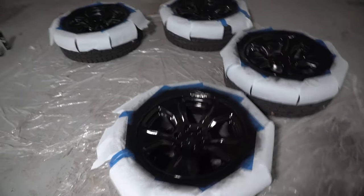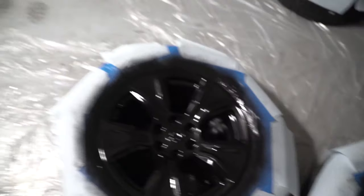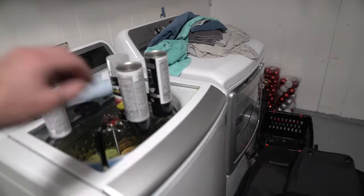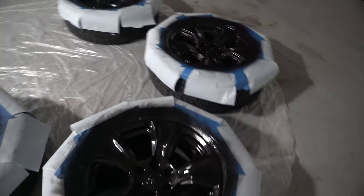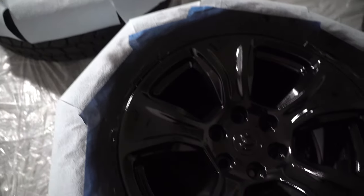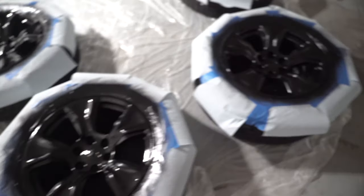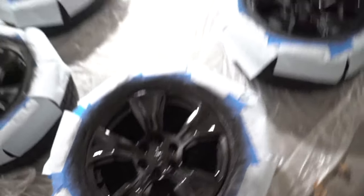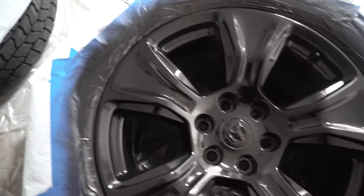We had to add a heater because it's a little too cold in here for these to cure properly. I also had to shut the garage because some of the dirt was blowing in. What's crazy is I've only used two cans — just barely started on a third can for this last coat. If you've ever worked with Plasti Dip or any other removable coatings, you know that they dry really chalky and flat. But look how glossy this DupliColor brand is — and this is without a clear coat. I'm still going to add a clear coat tonight once these dry a little bit more.